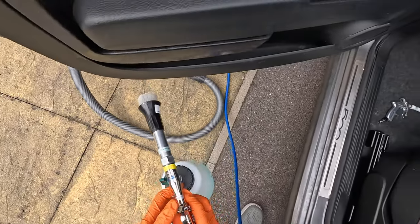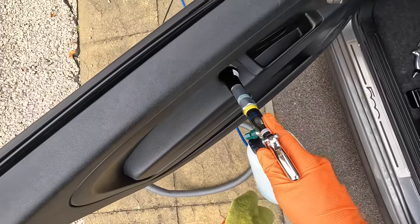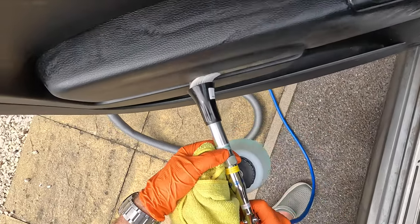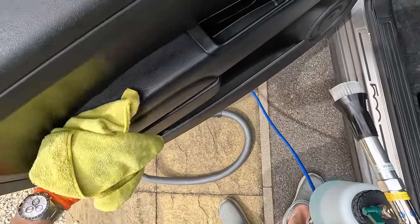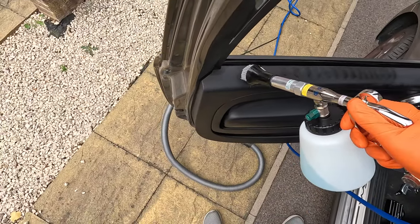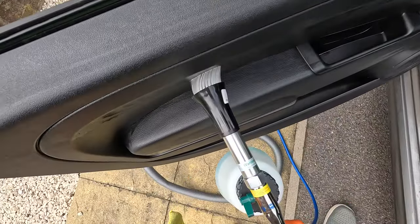The amount of time the tank stays charged for is about 30 to 35 seconds of continuous use, which is maybe not enough. However, I've found you don't use it on the whole piece of a door or trim — you use it on spot areas where you really need the high pressure air, and for the rest you just use your cloth and some cleaner or a light misting. In here I'm using ONR as my interior cleaner. The air was really doing the work and the combination of those two things left a really good result. This is the right time to use these tools — it's a pretty dirty car. For well-maintained cars you won't need them, but it's fantastic for deep cleans when needed.